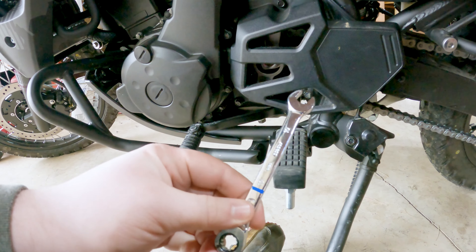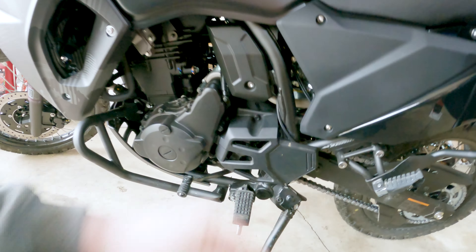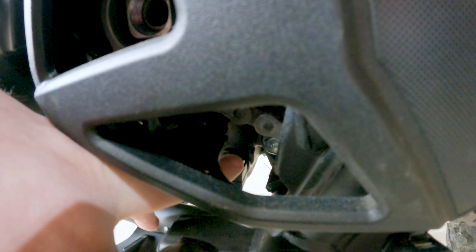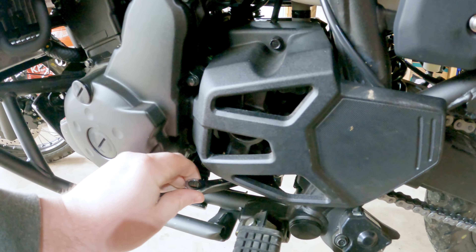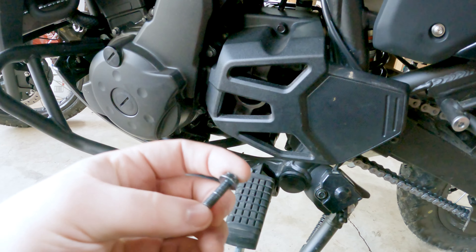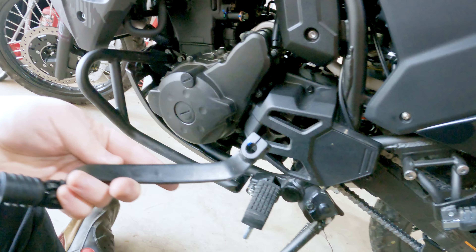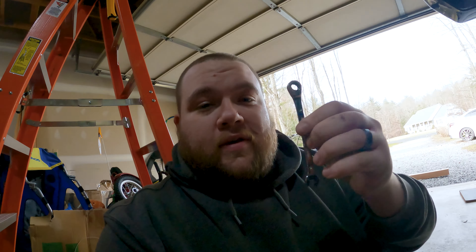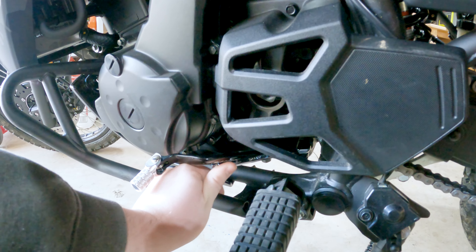This is a really easy install. Anyone that has a 10 millimeter wrench can do this job — it takes zero brains, it is super beginner. Right back there there's a bolt. Get the 10 millimeter wrench on the bolt and just loosen her up. The bolt has to come completely out of the shift lever in order for the lever to come off the bike. I lied when I said you only need a 10 millimeter wrench — the new one requires an 8 millimeter wrench too. They do provide their own bolt, so you need both a 10 and an 8 millimeter.